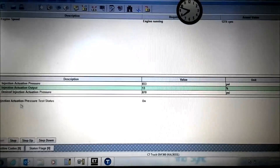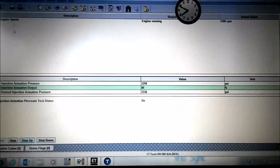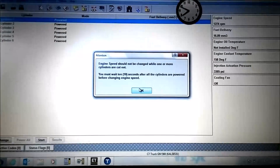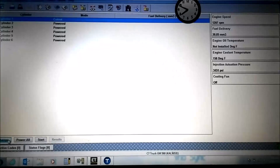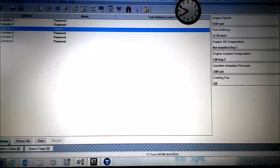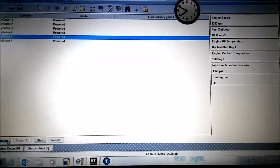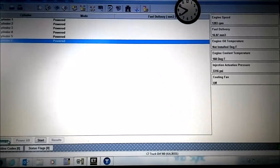So I was running it on very low pressure, and we're going to bump it all the way up to max pressure — 3,300 PSI HEUI pressure. You're going to see that number six actually starts to fire. Not fully — it's not going to be even with the other cylinders — but it'll actually start producing a little bit of power under max HEUI pressure. This is a good troubleshooting tool because that means you probably don't have a problem with your valve train, because if you had a valve train problem the HEUI pressure wouldn't affect that. Same with cylinder damage. But since it's firing a little bit once you increase the HEUI pressure, that's pointing more toward the injector.